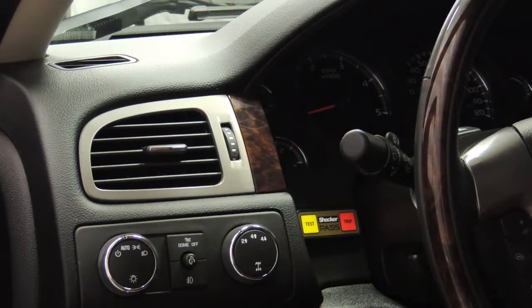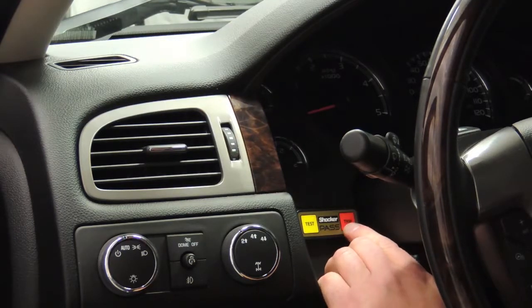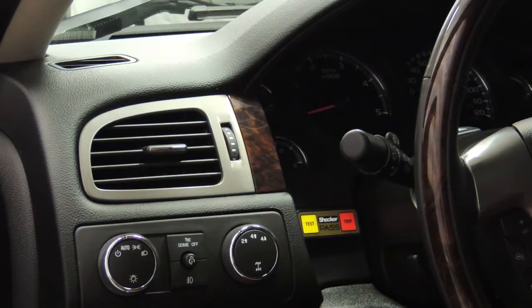Basically at the end of this, now we want to test our in-cab keypad. So this has two functions. One function is so that you can manually trip the valve just by hitting this trip button. As I previously stated, if you command the valve to shut, after it has not seen any engine RPM for 15 seconds, it will automatically reset itself. So you never need to, after a manual trip, go through the trouble of opening up the hood to reset the valve or anything like that. It does it all on its own.